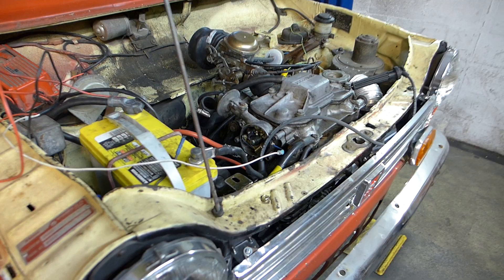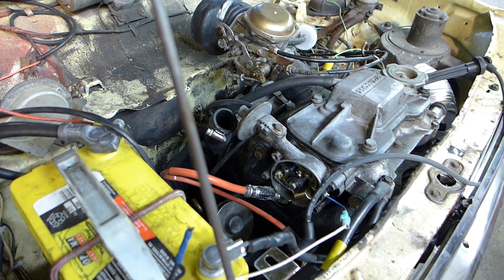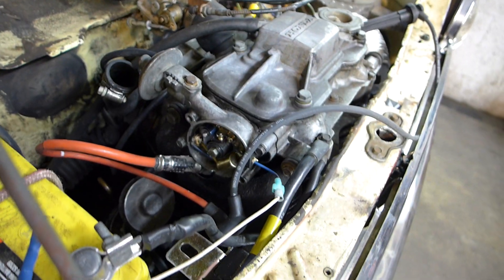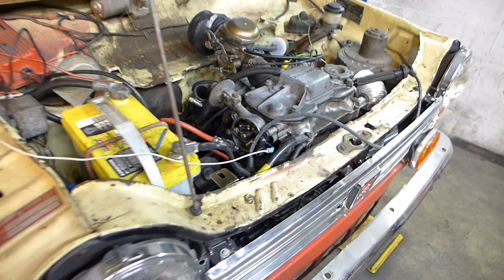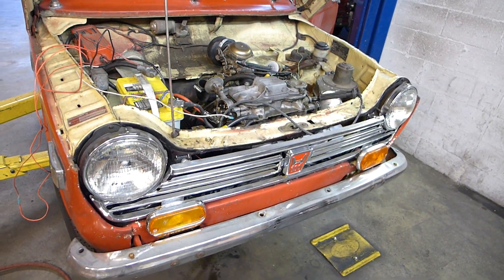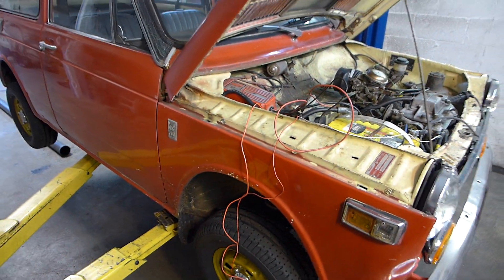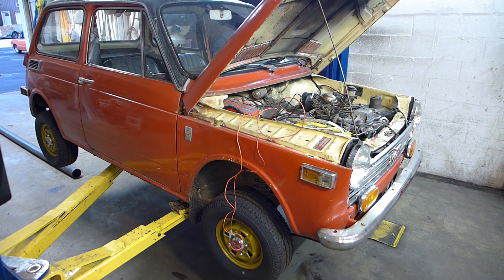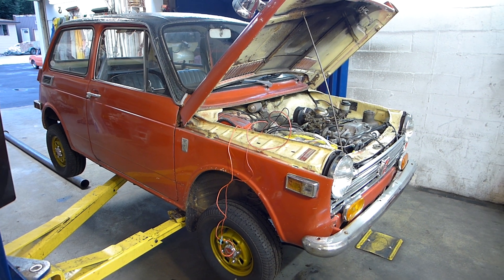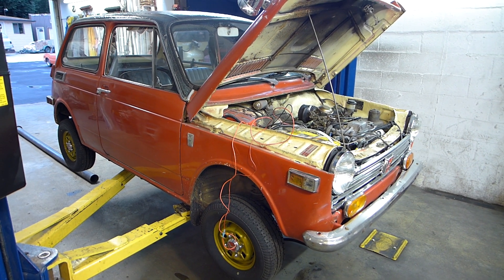Crazy old Hondas — they're two-cylinder, and of course MSD will never tell you that'll work on a two-cylinder, so you'd have to just use it on the four-cylinder setting, and it seems to work fine. Now the points will never burn because they're simply used as a trigger — there's no current going through them, which is really nice. I kind of wanted to design an electronic ignition, and that may come someday down the line, but for now this is what we've got — our little N600, an unsynchronized early car with the early carburetor and unsynchronized transmission. Maybe I'll do some 0-60 test runs with the new ignition and see if it improved anything. Thanks for watching, and I hope my miss is gone.